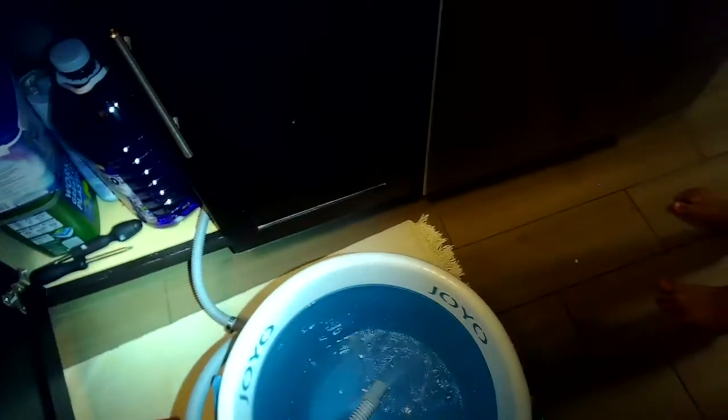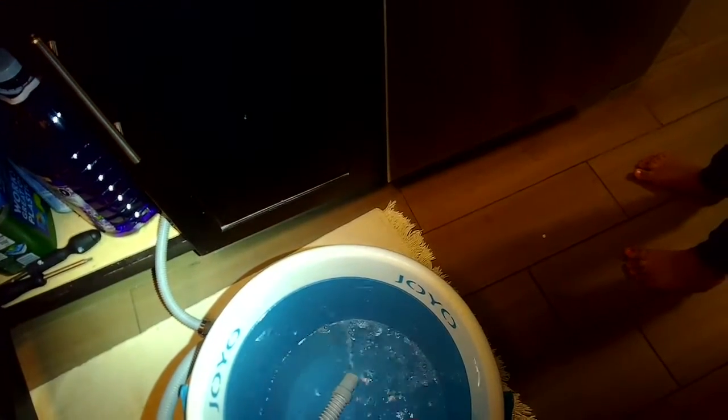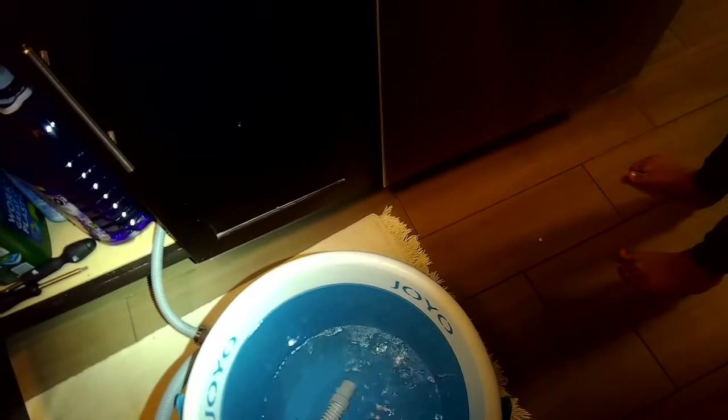So I'm just letting all the water come out from the LG dishwasher, and again, once it was disconnected, it seems to be flowing pretty good. When you do this, you can also shake that gray tube, and that may help to work loose any food particles or whatever may be in there that's causing it to be jammed. The biggest complaint we have for dishwashers as technicians is ones that won't drain. This is pretty common. So I'm going to go back underneath the sink now.